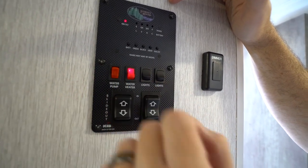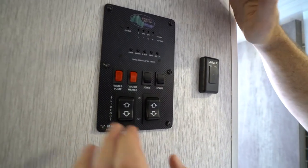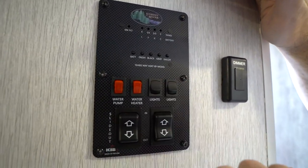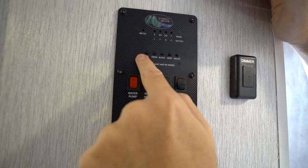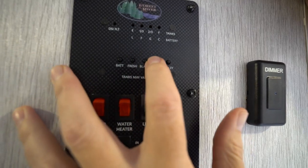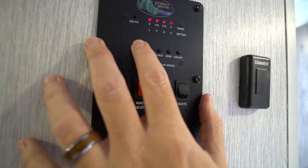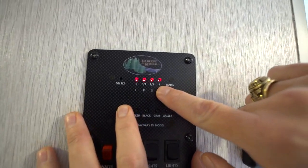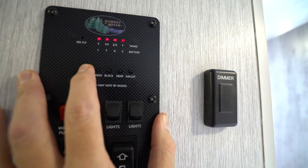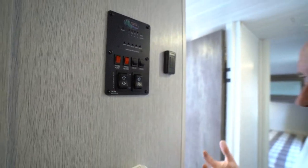You do have a water heater on there. You'll notice it's trying to light the water heater now, even though we don't have any propane — once it does light, that light will go off. You've got your light controls to the right of those, and then your info commands right here for your battery to see how much power you have, and to check out your fresh, black, and gray tanks. If you're running on coach battery and you notice your slide isn't going out, check the battery — if you're below two-thirds, that's because you don't have enough power on the battery to run the slides out. You really need over 11 volts — I even say 12 — to get the slides to go out properly.